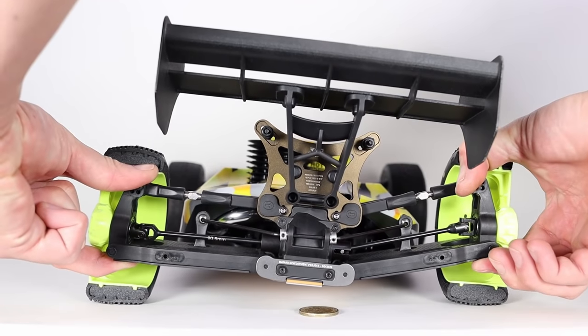But now we want to talk about jacking, because there's one distinct thing that happens to the car due to these forces traveling through the arms and links, other than load transfer to the outside tire. And that's the fact that when the roll center is above ground level, there's a vertical component to these forces. That vertical component will lift the car up.